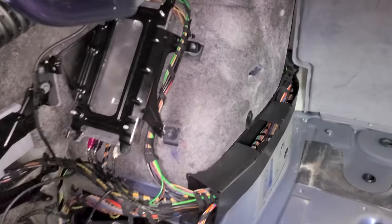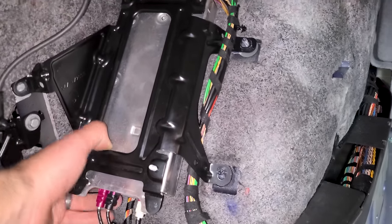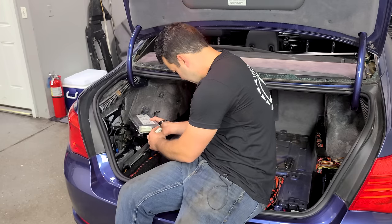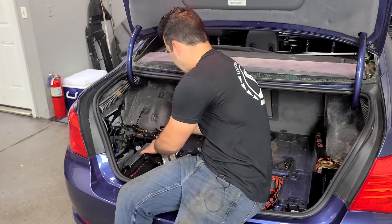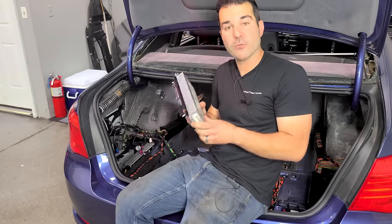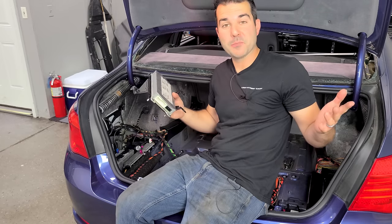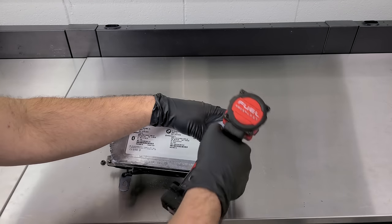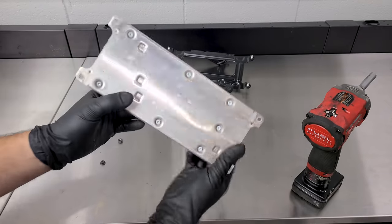Starting with this module - I'm not going to show you how to remove each and every one of them, it's very easy. Basically there are brackets, a couple of 10mm bolts, and most of these just lift right out, then you go around and disconnect all the connectors. This control unit looks to have taken on more water than the Titanic. I'm going to show you the easiest, most DIY-affordable method of cleaning control units. We're going to go module by module and take them all apart so you can see the guts, the circuit boards, of all of these control units.